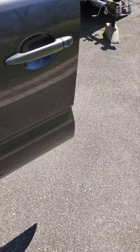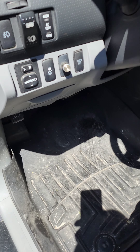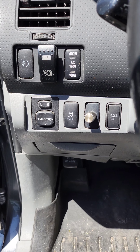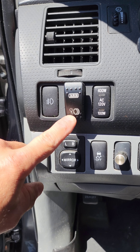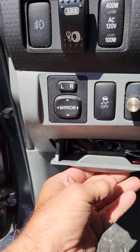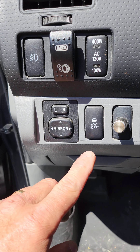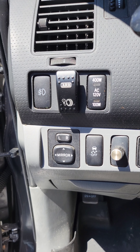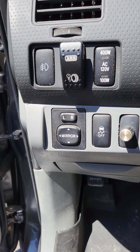As you can see it's connected here, grounded right here. This is my fuse connected to my power for my battery. And if you come inside my truck, that's my ARB compressor switch. The switch also has a fuse behind my fuse panel, and it has its own separate fuse as well. It's hardwired directly into my truck. I'm going to turn on my truck, turn on the compressor, and show you how the components work.